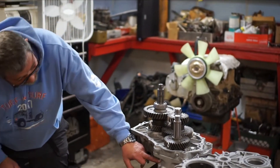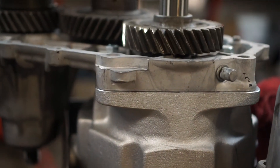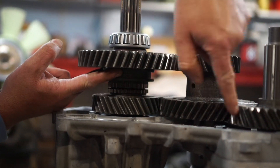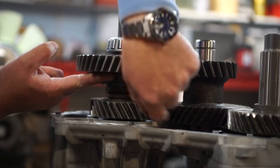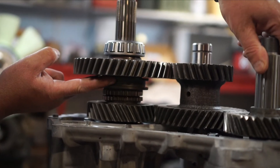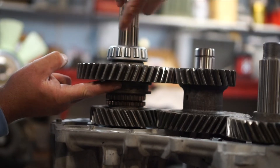Transfer case adapter right here — it goes from the Chevrolet pattern to the Toyota Land Cruiser. This transfer case is getting a whole new rebuild, new bearings. So we put it in low range. The drive still — this is mechanically connected — but now this is free-spinning right here. So this is going to be multiplied. This ratio is actually 1.99, so almost two to one — two turns in to one out. See, that's slower?